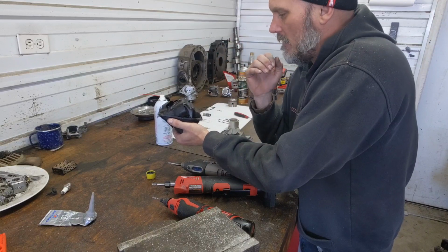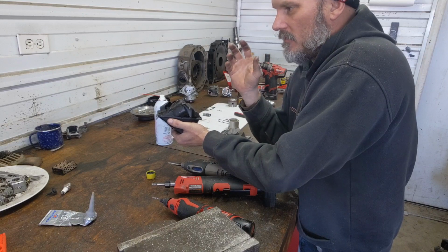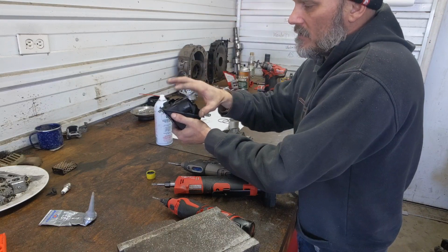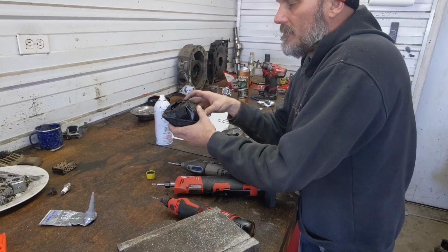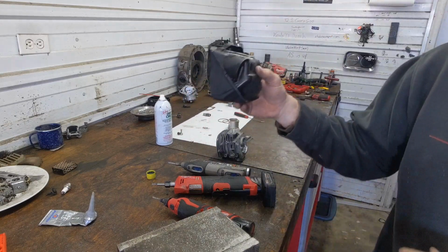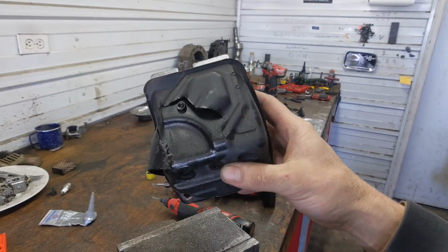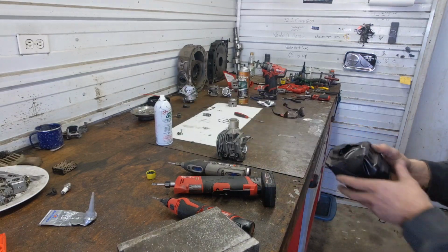They look cool, they sound awesome, but when you're cutting a lot and you've got wood right up against the face of your saw, it tends to either burn the wood or blow chips in your face. A deflector spreads the exhaust out a little bit better and keeps stuff from kicking back in your face and sawdust running all over the place. But yeah, that's how I like to do mine. There's just a hole underneath there. It's not pretty. I don't care. It's effective. Sounds cool.